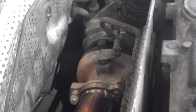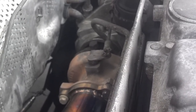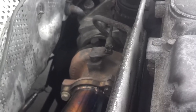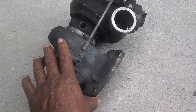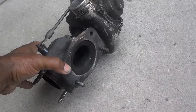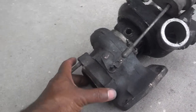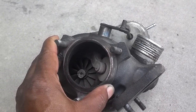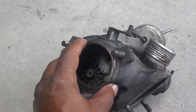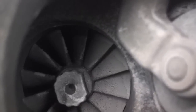In general, your turbocharger is attached to the exhaust manifold. All of the air that comes out of the exhaust spins a turbine on the backside of the turbo. Here's a turbo that's not installed on the car. This part, called the exhaust flange, is mounted on the exhaust manifold. All of the exhaust that leaves the engine will come through here, then routes into the backside of the turbo. You can see that turbine blade — it comes through there, making that turbine blade spin, and then comes out this large hole and down your downpipe. So the whole time the car is running, your turbo is spinning because the exhaust air is coming through there.